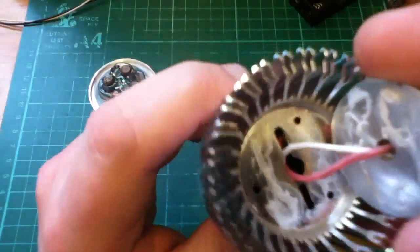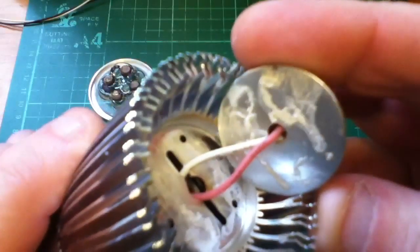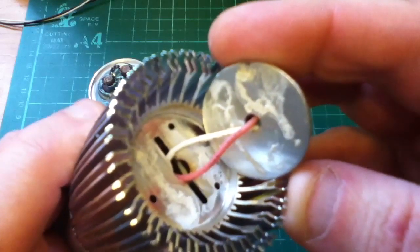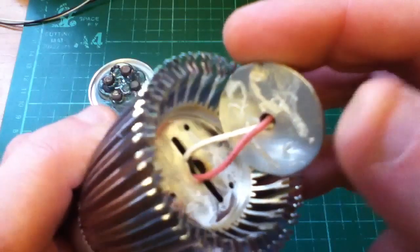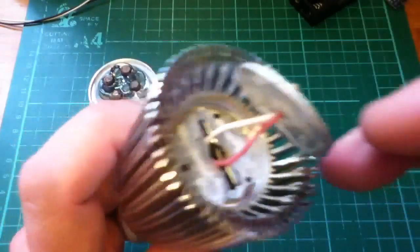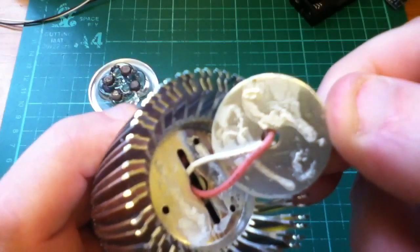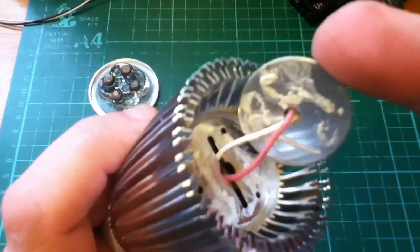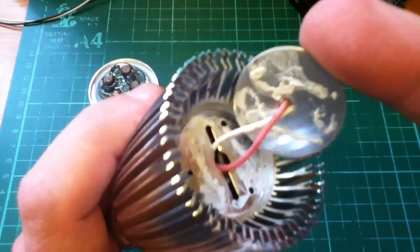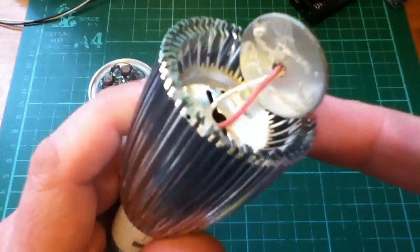I think I can see why this failed, because if you look at the back of the disc, see the white thermal grease — this is the paste which has the properties of allowing heat to transfer from the back of the metal disc here onto the metal of the heat sink, and then obviously dissipate into the main metal. But you can see this was never applied properly and thoroughly. There are large areas of the metalwork there that simply don't have any grease on them. So this was just under-greased, and heat built up on this front plate and never got a chance to flow into the heat sink.